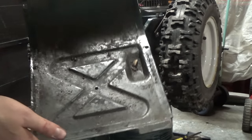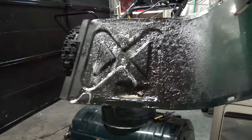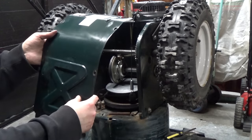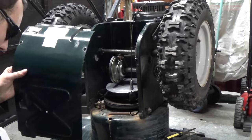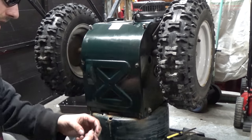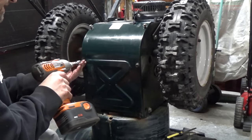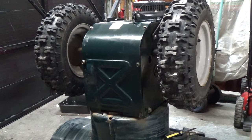I'm going to clean that out with a bristle brush before putting the panel on — just using a little bit of Spray Nine, spray it on there and take it off with a bristle brush. A little bit of degreaser and it's good as new. You might ask why I cleaned that — one, it just looks better, but two, if I remove this next year for inspection during an oil change and I notice some metal shavings or oil buildup, it gives a good indication of how the machine is doing. A lot of people won't check their own oil and rely on services like this to do oil changes, maintenance, and general inspection so you can diagnose issues just by looking at the inside of that access panel.